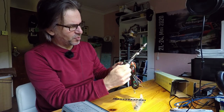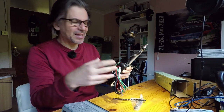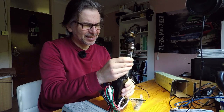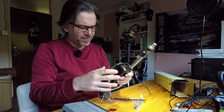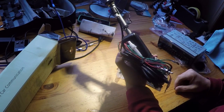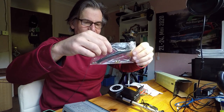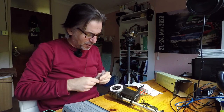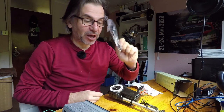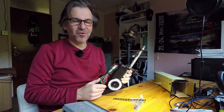The grommets go into the body and we'll take power off the back of the stereo. The earth will probably stay somewhere in the engine compartment. It's a bit bulkier than the original, but I think it'll be fine — it's a period accessory and true to my policy of OEM+. There are also fixings for the bracket, and a drain tube — a little piece of plastic tube that slots on the bottom because water can get in, and it needs to come out again. Let's go out and fit all this to my Mark II Golf GTI.